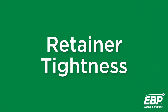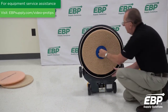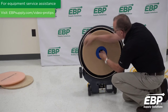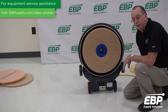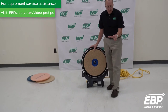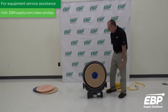The next problem is the retainer itself. People many times don't screw it in far enough. You need to screw it in so the pad is really concave in the center. Hold the retainer and turn it nice and tight until the pad is concave — this way the retainer will not touch the ground. A common complaint is swirl marks on the floor: if you have a four-inch-wide swirl going down the floor, it's the retainer dragging on the floor.